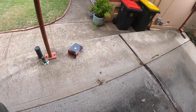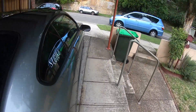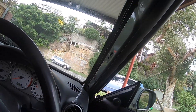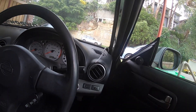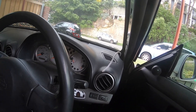I ended up picking up the same Boost Gauge that I had before, the same TurboSmart Boost Gauge right here, and that is obviously going to go right in here. Now I am still waiting on getting my Boost Gauge Pillar — it is coming in the mail — but for now I think I'm just going to put the gauge there and tape it down, just so there isn't a boost leak or anything like that.